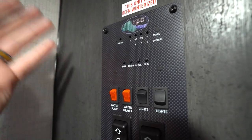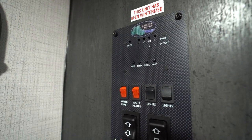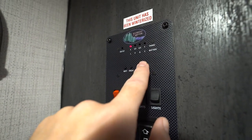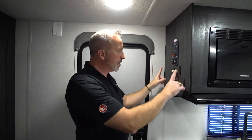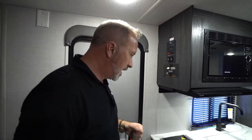If you're hooked up to shore power and the slide is still not running out, bring it in and let our folks at Camping World take a look at it. As far as your tanks — fresh, black and gray — if you have flushed these but they're still reading two-thirds or even full, chances are there's a line of water connected between the two sensors on the side of that tank. Give it about 15 minutes — that should drip down and give you the true reading of empty. If not, chances are something's wrong, maybe a sensor's bad — bring it in.